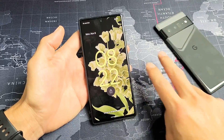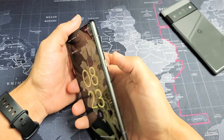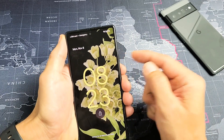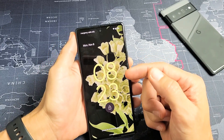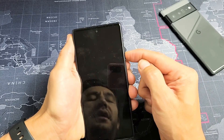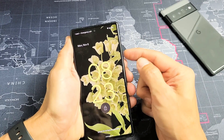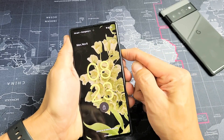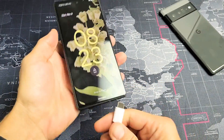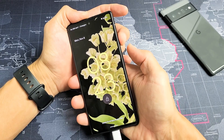If you're still stuck in a boot loop, we're going to go to option number two. So you're still stuck — no problem. What we're going to do is spam the power button: press it in, out, in, out. Don't do it too rapidly because you may trigger the SOS emergency phone call. Just keep doing this. The premise behind this is that your power button could be stuck, jammed, or maybe you have something sticky in there — soda or coffee — and a stuck power button can cause a boot loop. Now go ahead and grab your charging cable and plug it in.